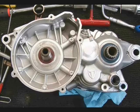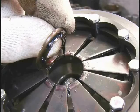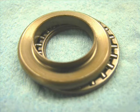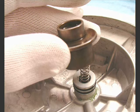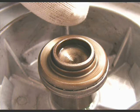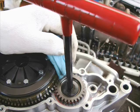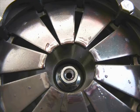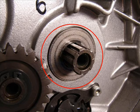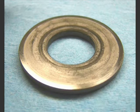This is what the left case half looks like with the magneto taken off. I lay out my center case bolts on the workbench. On the right side of the engine is the clutch — you'll see a few little parts that may be stuck to the clutch when you take off the outer clutch cover. This is what the interior clutch cover looks like. There's a slave piston, a flat bearing, and a little bushing. This is the primary driven gear — it's a big allen. Before we take the clutch apart we're going to get this big bolt loose. Then we take out the center bolt in the clutch, which is hollow so that the engine can vent, and it has a thick washer. When you remove the clutch you will see a special washer — the flat side faces out and the back side has a step in it which faces the bearing.